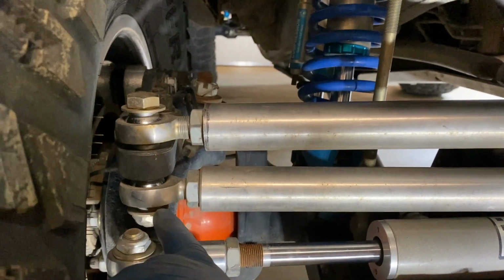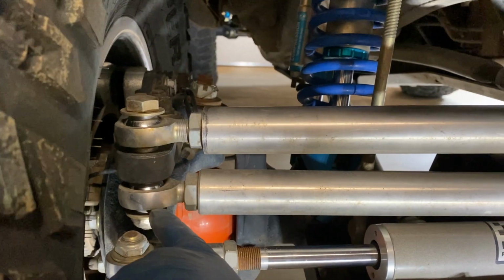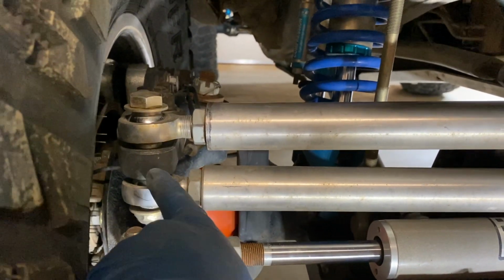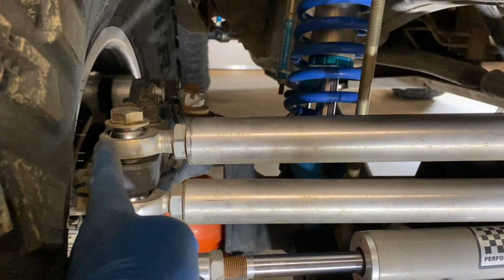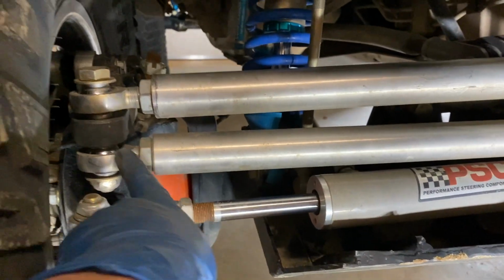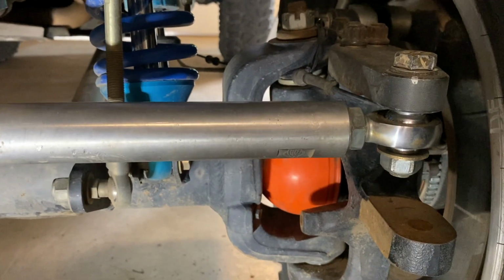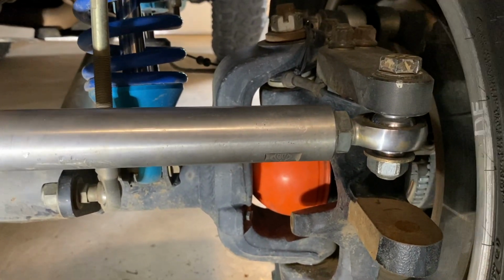So now, just like we talked about, because I need misalignment spacers this exact size here and here, and now I need them here and here as well. That's 4 misalignment spacers. Because I have to do it on this side, that means I have to do the same thing on the driver's side too. So that's 6 misalignment spacers that are wider that I need to make narrower.